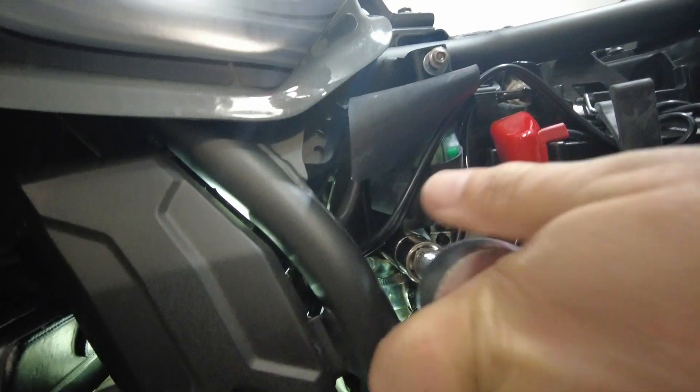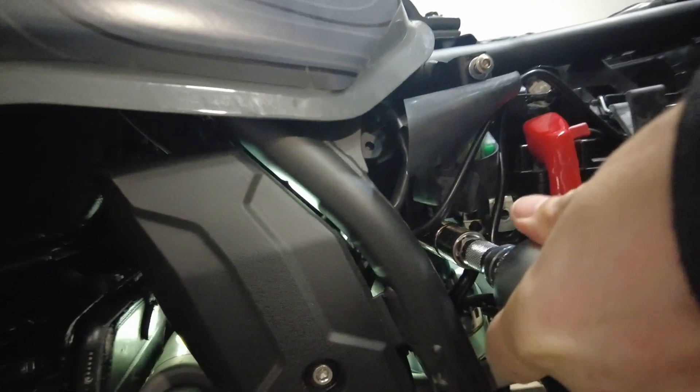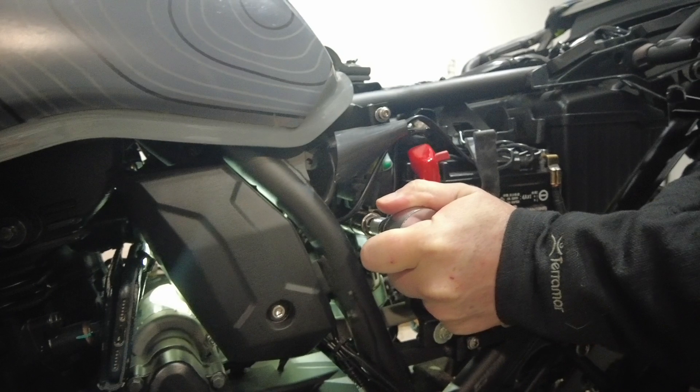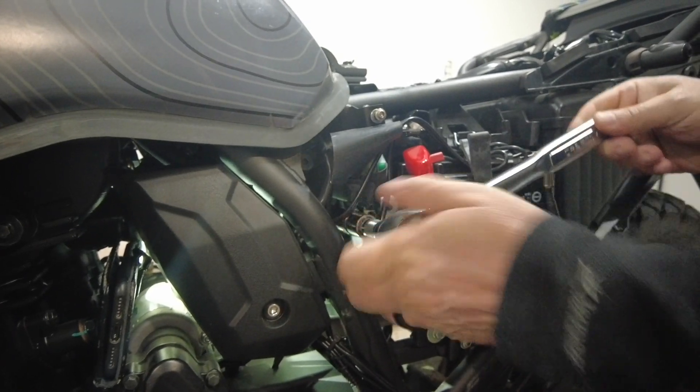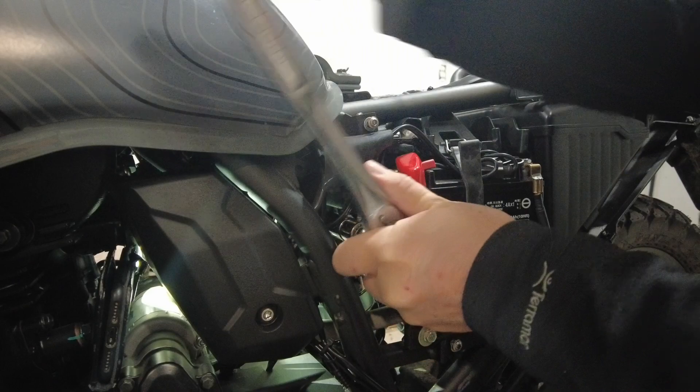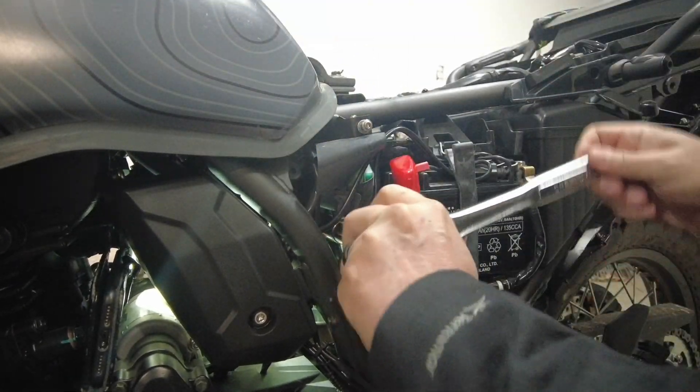An 8 millimeter fits right on there — just loosen that bolt. That should give you enough space to move this around. You've got to push this up a bit so you can get access to the top right there. To reach that 17 millimeter bolt, we've got quite an extension set along with the deep well socket. You can see it fits in there once this thing's out of the way. It's torqued on there pretty good, so that's why I'm using a decent-sized wrench. We're just going to loosen it — not take it all the way out yet.